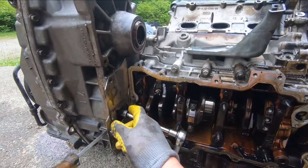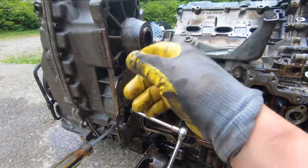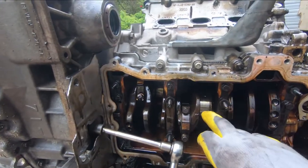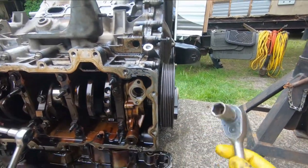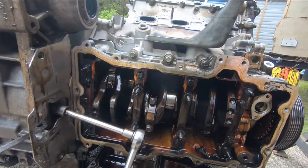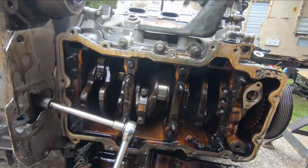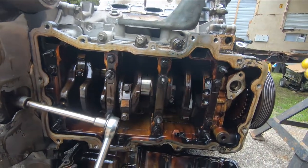What I'm doing here is disconnecting the bolts that hold the torque converter to the flywheel. I had to take the pan off again because I took some bearing caps off, and when I went to turn it I couldn't — it was coming up against those disconnected connecting rods. So what I did was get two of the pistons up far enough that they're out of the way, and I put this one on loose so now I can turn the crankshaft.